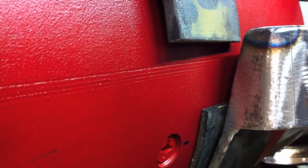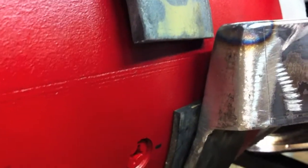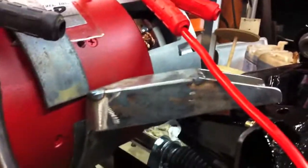And then I welded little extension plates — you can kind of see right up the edge here. They were about two and a half inches tall and a little bit wider than the piece of metal there, so I cut them down to size afterwards. And then we were going to use the actual motor mounts — there's one of them there — but they actually hit on the side of the motor, so that wasn't going to work.